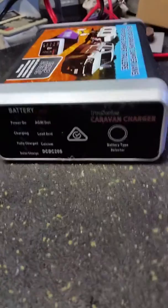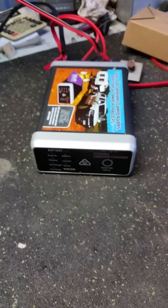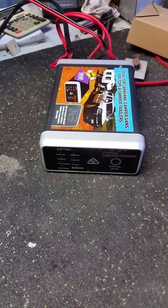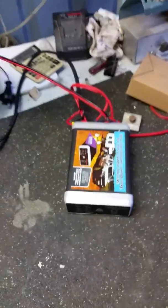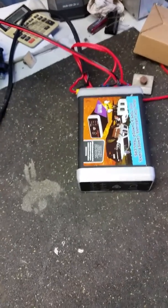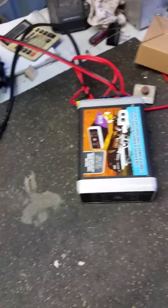It's not going at the moment — it's all connected up, but as with all of these units, it operates by the primary battery having a voltage greater than 12.5. If your alternator output or vehicle battery drops below 12.5, this will switch off. So you've got to have decent cables running between your tow vehicle and the caravan. With maybe 10 meters of cable, you should be using around 10mm square cable on your vehicle and something similar through to the battery, just so your voltage stays above 12.5.